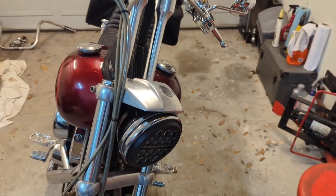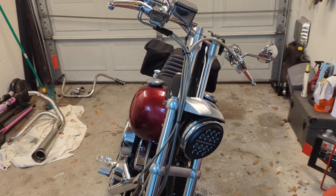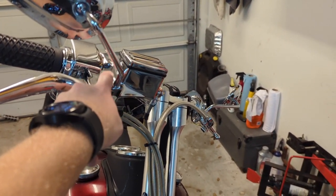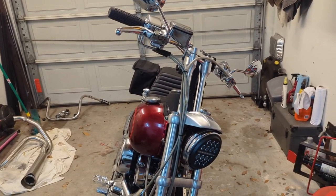I had the headlight out, so I started feeling around and looking in the wires, and I noticed there was a particular wire that was really warm, and when the circuit breaker went, it would cool down, and then when it turned back on, it would get hot again. It was a gray wire that went to the ignition on switch and start switch, they're kind of wired together. So that gave me an indicator that something was wrong there.